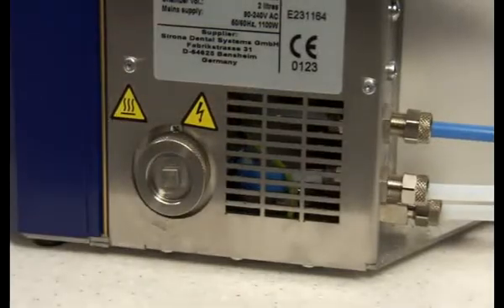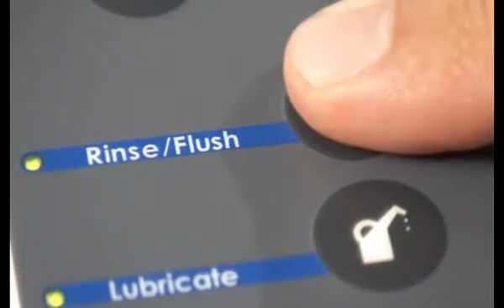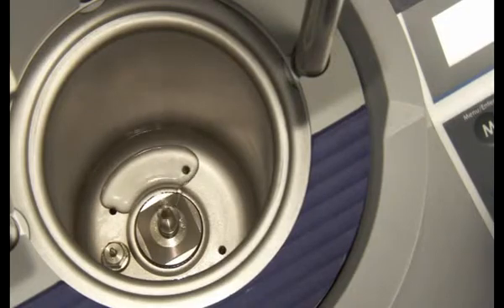Filters must be changed every four weeks. To check the water function, look down at the bottom adapter in the chamber. Press the rinse flush button and hold it until water exits the bottom adapter. If no water enters the chamber, please call your supplier.